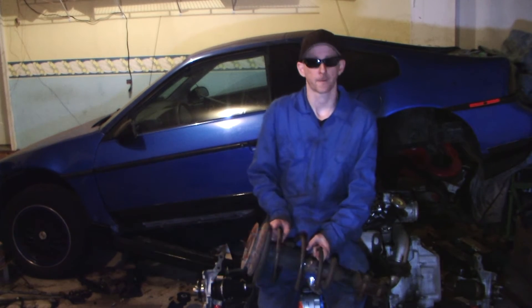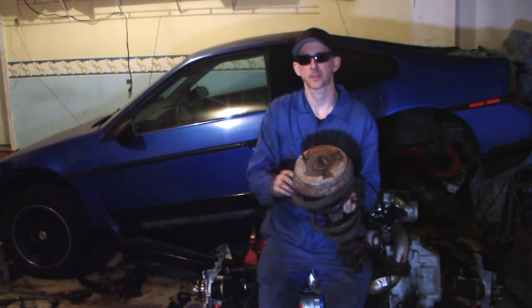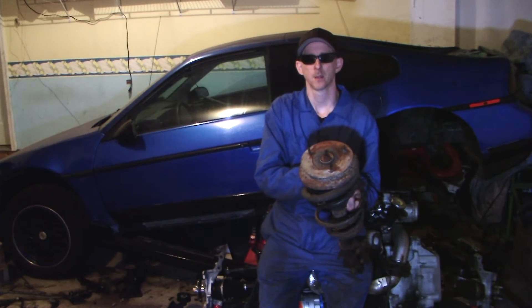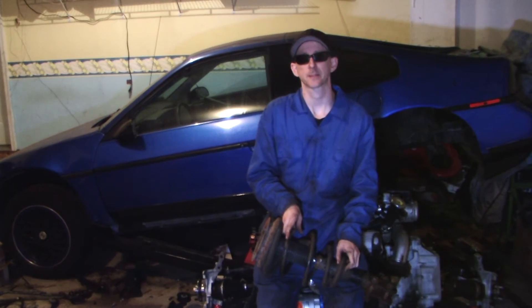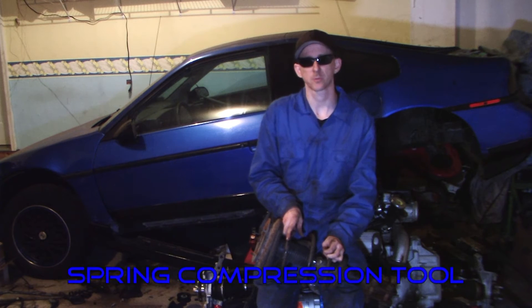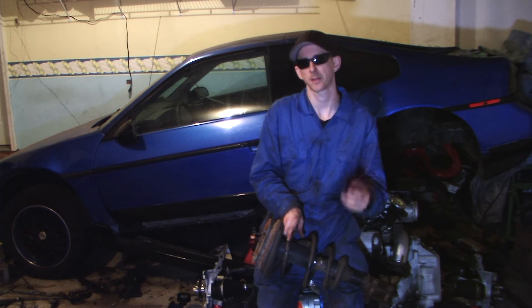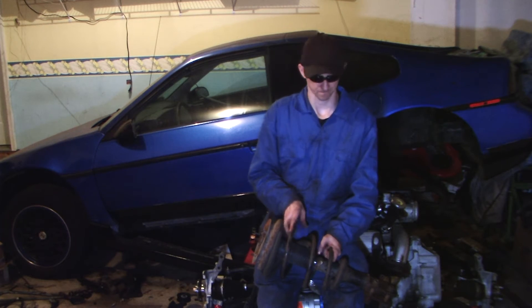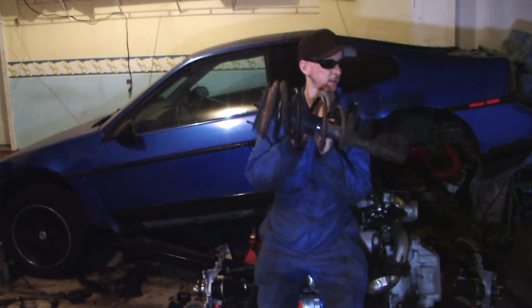You can probably find them at your local store or elsewhere. Also, there are three bolts up in the engine compartment. Once you get the strut out, the next thing to do is get a spring compression tool. If you don't have one, you can get one at your local auto parts store — usually they loan them for free or for a deposit. Once you get that, you're ready to go. We'll start compressing the spring and then getting it apart.